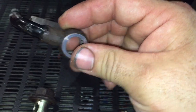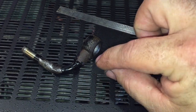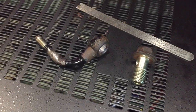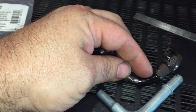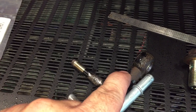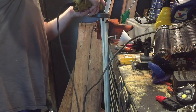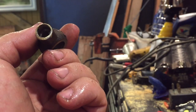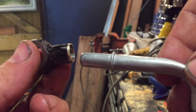The hole in the banjo fitting is a 14 millimeter hole. These parts are available on eBay — you get a bolt and instead of a curved fitting you get a straight fitting with barbs to put your hose over and clamp it, but there's no room on this car for that. Unfortunately I can't wait for a part because this vehicle has to be on the road again tomorrow. I went down to my local NAPA parts store. What I'm going to do is cut this pipe off right here at the base of the flange, insert a new drilled pipe into that, weld around this ring, and then reattach my hose to the new pipe. This is what we ended up with after cutting off the rest of the pipe and drilling through the center, boring it out a bit further. This other purchased piece is going to go right in here.